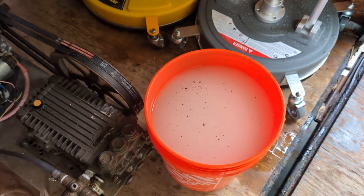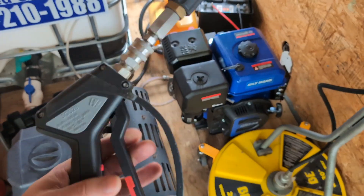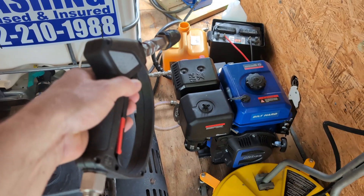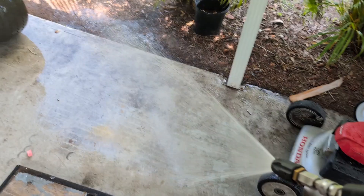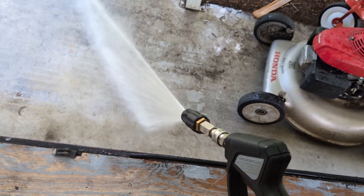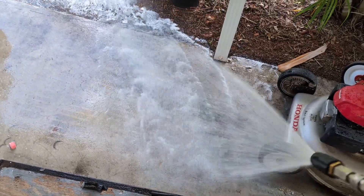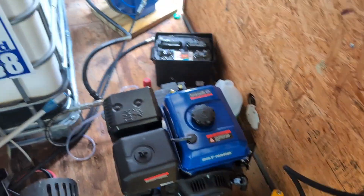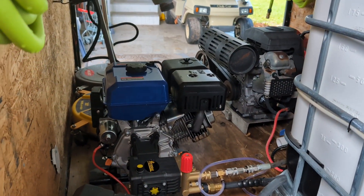We're getting more than four gallons per minute — probably four and a half gallons a minute! Now we're going to switch over to this gun which has the DS twist on it, the M5 twist, and we're going to downstream some chlorine. The test came out really good on the machine, I'm very happy with that. I'm getting close to 4.5 gallons per minute and the PSI is about 3,800 — not quite 4,000. Anyways, hope you guys learned something and liked it. Remember, give me that thumbs up, subscribe, comment, and thank you all — bye bye!